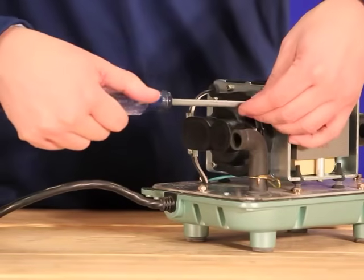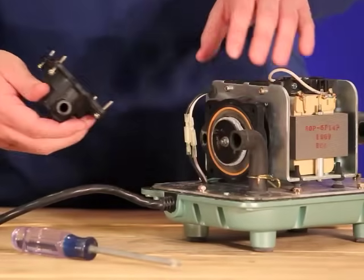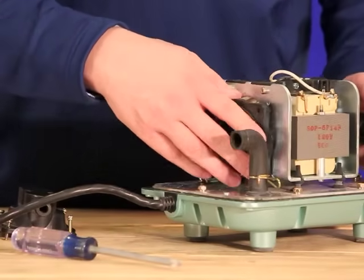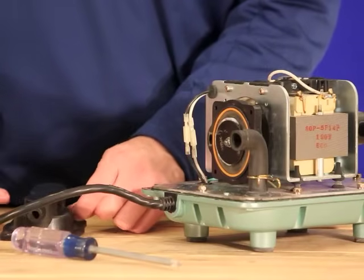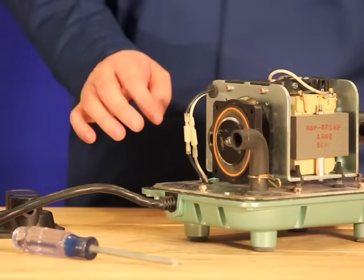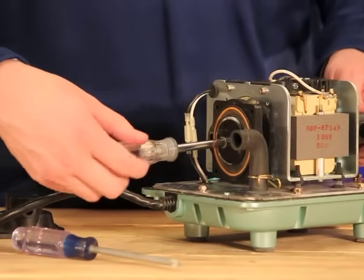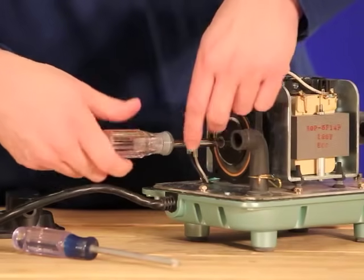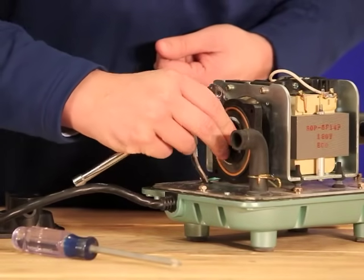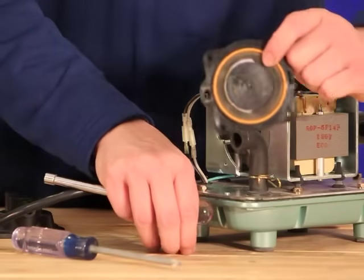You are going to take these four screws off of the end. Already you can tell that the diaphragm on this end is ruptured — you can see it almost peeled right off. It is however still attached in the middle, so I'll have to take that bolt off. These four screws that you took out you will want to keep because you will have to reuse those. This center screw here is a 7mm nut — it is metric, it looks like it's not but it is — so you will need a 7mm socket to remove it. Then the diaphragm will just slide right off, and you can see one ruptured diaphragm gone.